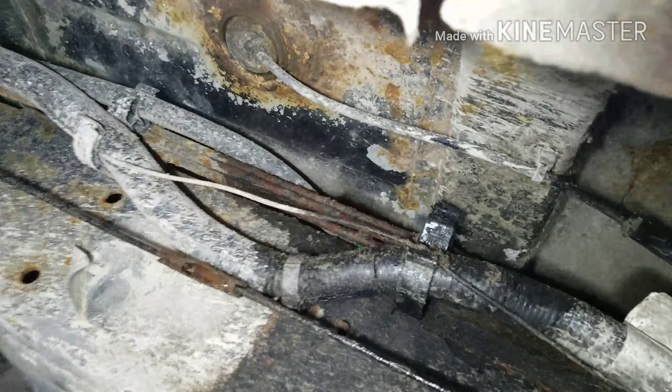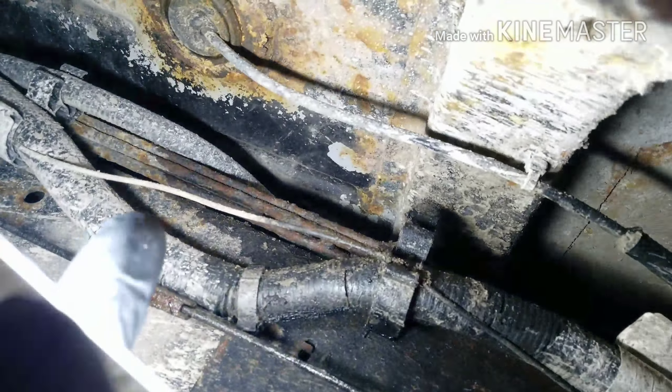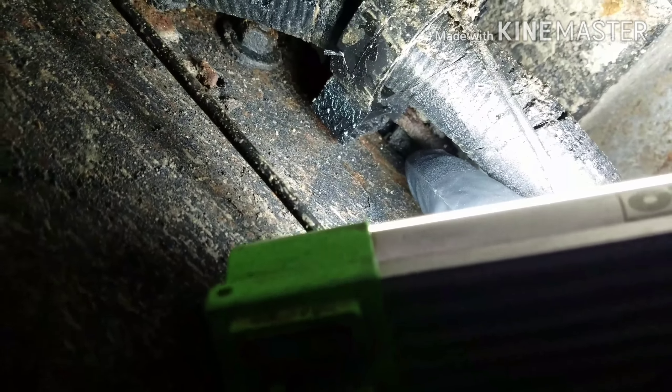Right under the driver's door right now, and there's four brake lines right here. I had someone press the brake so I could see where the brake fluid squirts out. Right where the tip of my finger is, there's a crack in the brake line — it just rusted through. That's where it was squirting out, so I'm just gonna replace that line.